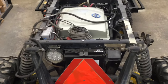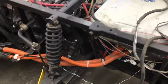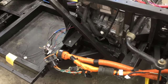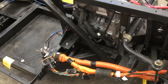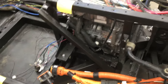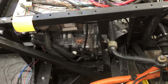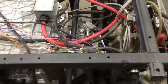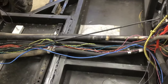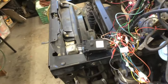I placed the 12-volt battery in the back — and there again you can see the charger. These two orange wires lead to the battery case: one takes power to the charger and to the inverter and motor, and the other is the actual charger input — the one with the orange door. Here you can see the radiator hoses coming out of the different units; the charger is likewise cooled by water, and those hoses run to the front end and connect to the original Ranger radiator and fan system.